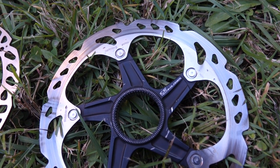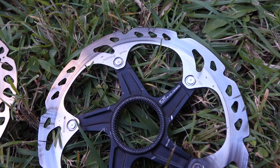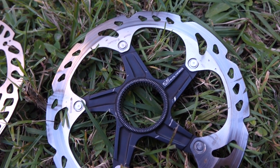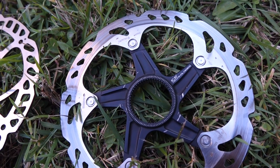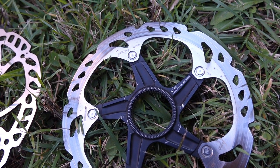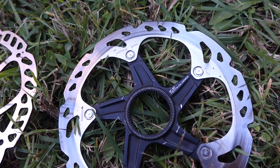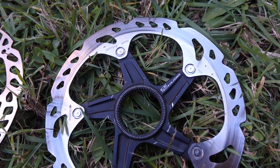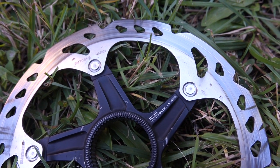I was thinking, as you usually do, that it must have been the brake pads or that they must have been contaminated. All those videos say if it's squealing then your brake pads must be contaminated. But it was actually the disc brake rotor still causing the squeal because it was blue. So something to keep in mind.